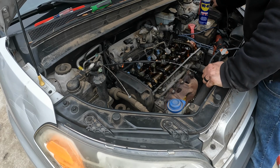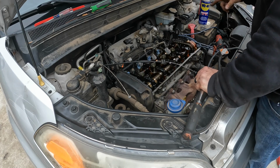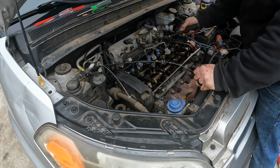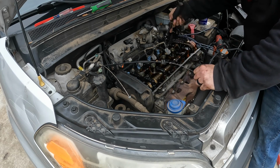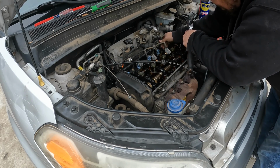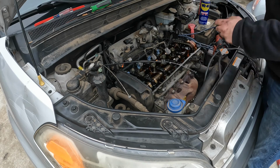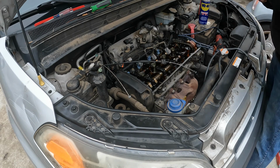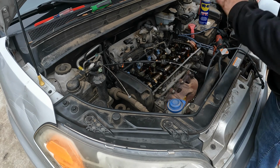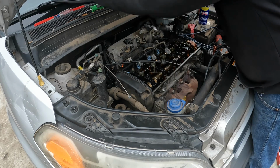All right, where was I? See about getting, where are you? Here you are. See if I can get these fuel line bolts to come out. Actually, it's just one bolt. I thought there was two, because there's not one on the other side of the regulator. These are 12s, yep. May just pull the whole rail out without taking the line off, and we'll just fold it over. That may work a little bit better. They're 12 millimeters. That's the wrong socket, but they are 12s.